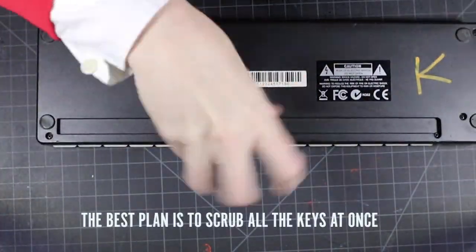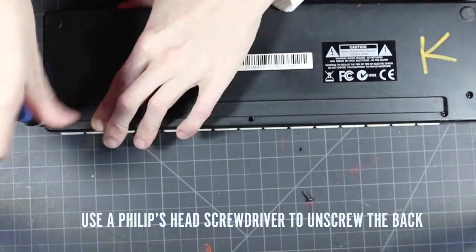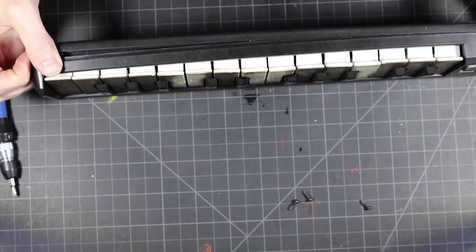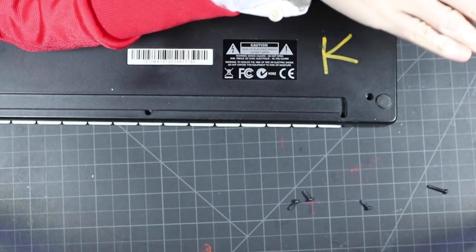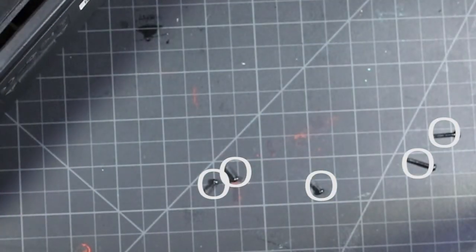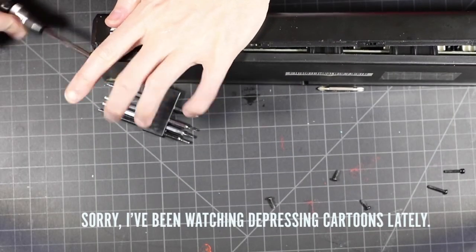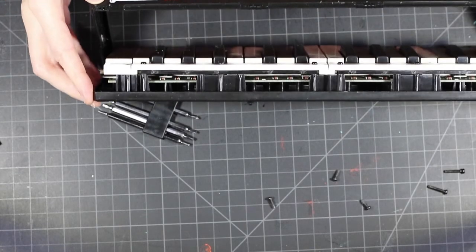So here's what I did, and what I think you should do. First, grab some Phillips head screwdrivers and start unscrewing all the screws. There are two halves held together by these screws, and there are also two different sizes of screw — you'll want to note which size goes where, or you'll be disappointed when the screw strips out in the wrong place and you have to settle for two less screws holding everything together. Crack the case open like a walnut, and carefully start unscrewing the screws that hold in the keys.